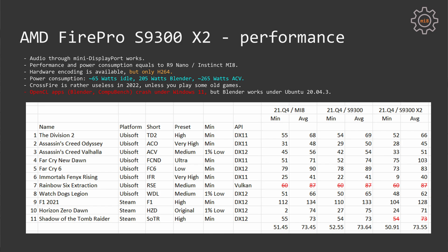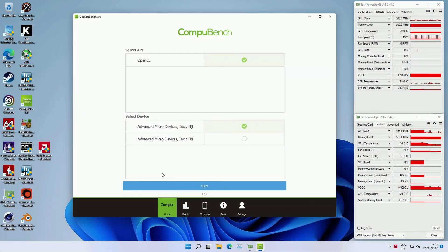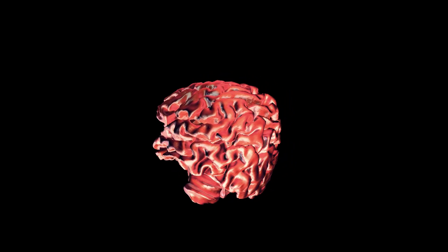Many people reported that audio over DisplayPort does not work with the Instinct Mi 8 graphics card, so I specifically tested audio through the mini DisplayPort on my S9300. With the S9300, the mini DisplayPort can play audio if you're using a compatible DisplayPort cable or a compatible DisplayPort-to-HDMI adapter. I also tested video encoding: H.264 encoder works, but H.265 is not available. Additionally, I experienced the same issues with OpenCL applications as with the Instinct Mi 8 — running Blender or CompuBench under Windows 11 causes the system to crash, so overall the system is not stable with OpenCL applications.